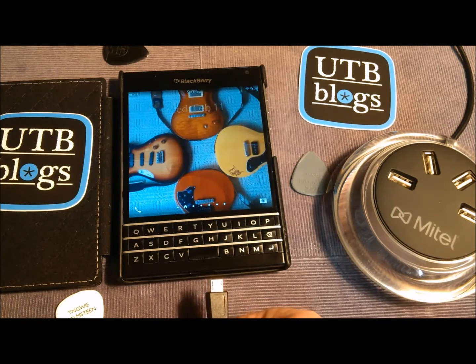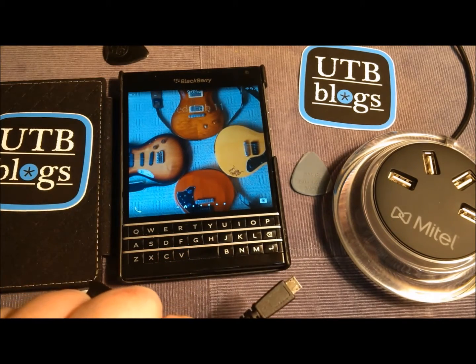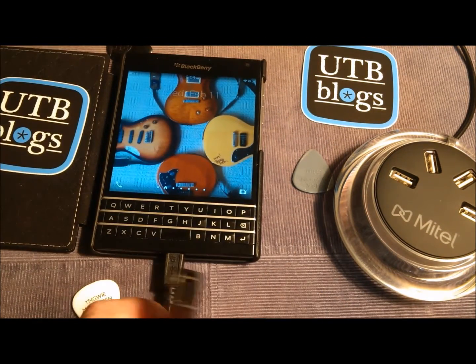If you look at this USB on the go cable — which is specific for the job, you can't just use any old cable, it has to be purpose-built — you'll see on one side there's one stripe in the middle, and on the other side there are two stripes on either side. It's always the one stripe in the middle that goes on top. Use that to plug in on top.